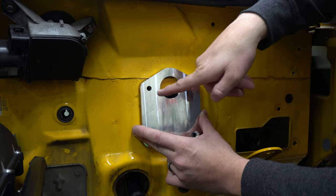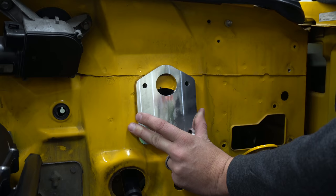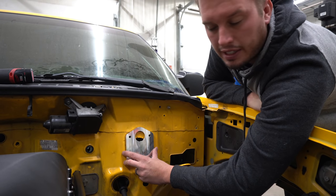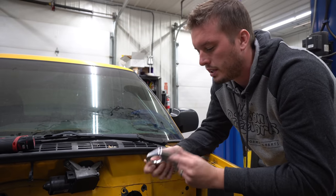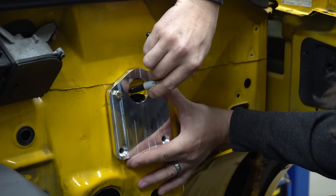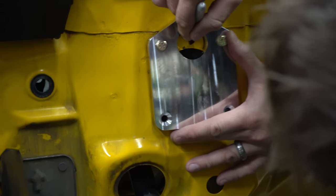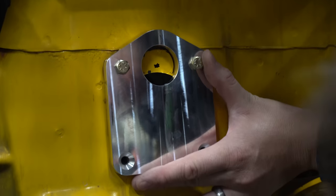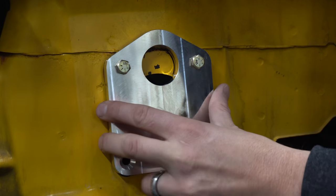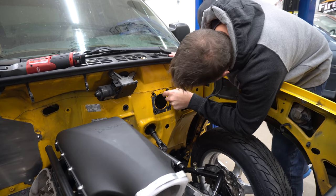You can see the factory hole — the brake pushrod is going to land right in the middle of it, and directly in line with that is the connection where the factory brake pedal was. Ours is moved up significantly higher because we're attaching the pushrod higher up on the pedal. So there is a little bit of modification required. We're going to go ahead and stick that right back up there, trace a circular pattern, and then use a hole saw that's a little bigger — we can estimate the center, or you can measure it. Having it a little bigger isn't going to cause any issues, so we'll mark it, drill a pilot hole, and come back with the hole saw to finish it off.